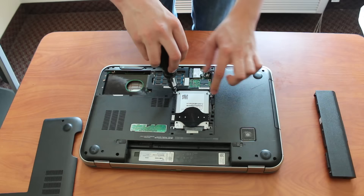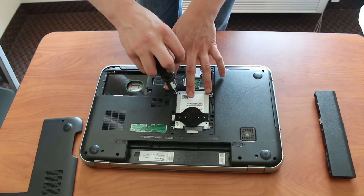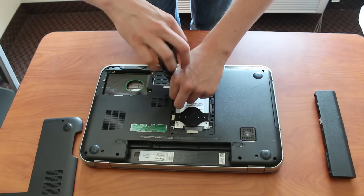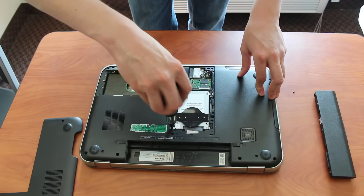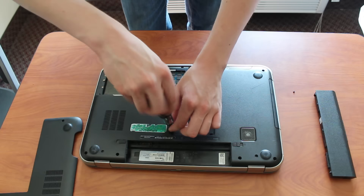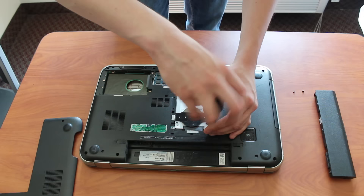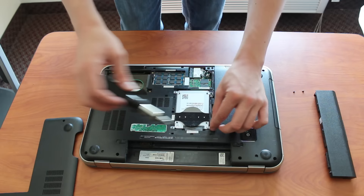On this laptop, there is a caddy around the hard drive, which is very common, where I have to take out those four screws around it. Then I pop the hard drive out with the caddy around it. So I'm just going to take out these four screws here. This is a Dell Inspiron 17R Special Edition laptop, so if you have the same laptop, this will be very easy for you. There are four screws around the edges, which is very common. Sometimes it's only two screws, and sometimes it's only one screw built into the cover that lets you slide out the hard drive.